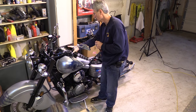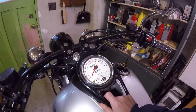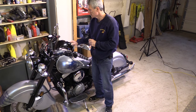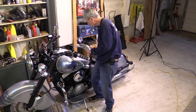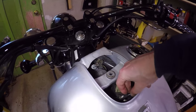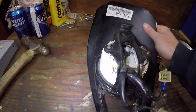There's a bit of a trick to getting the speedometer housing off — it has a small lip holding it in. You have to wiggle it a little, push it forward, and it comes right out. I've already unplugged the cables and the speedometer cable goes in right here where my thumb is. Looking inside you can see the male and female connector — remove the screws and it should just slide right out.